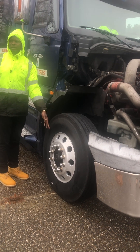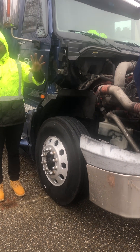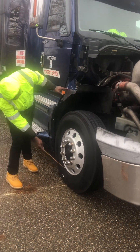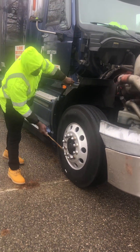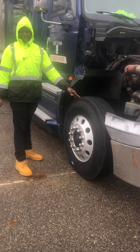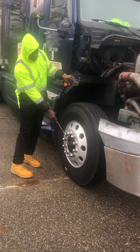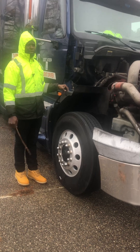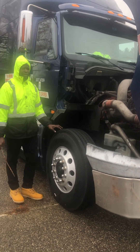If that hub fluid starts leaking it might cause your brakes to fail because it will leak into the brake pad and brake drum. That's why you check it for no leaks - if the hub oil seal has a leak, it would leak into the brake pad and brake drum. When you apply your brakes, they will also fail. I'll check my valve stem - mounted and secured to the vehicle, not bent, broken, or cracked. I detect no leaks. My air pressure on this tire should be at least 100 PSI - PSI means pounds per square inch. You can use a tire gauge or a rubber mallet to check your air pressure. The valve stem - no leaks. The inside tire should be at least 100 PSI.